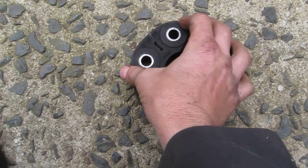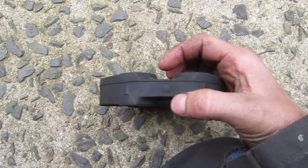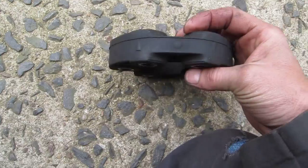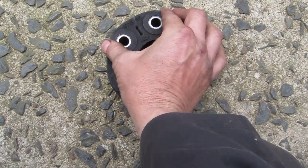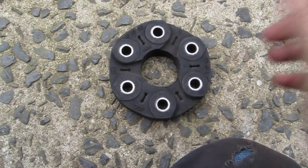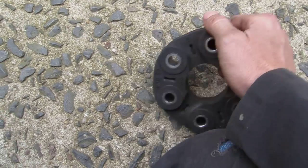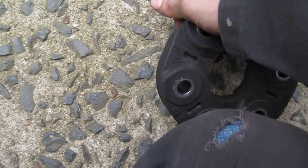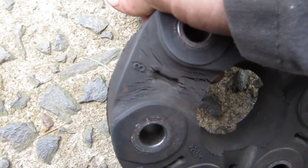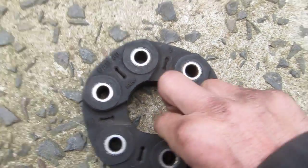You have the absorption you need but not a massive amount of compression. The stretching happens on the other side, but we don't really care about that — it's just a connector piece to keep things in unison. So now you have much less spring — customer lets in the clutch and no problems, no massive spring-back. Also, check your flex disc for massive cracking like this — this cracking is because it was stretched from that rubber band effect.